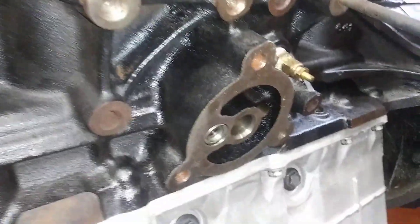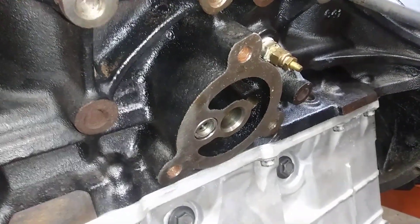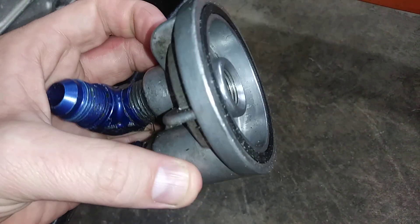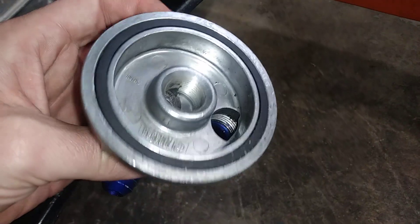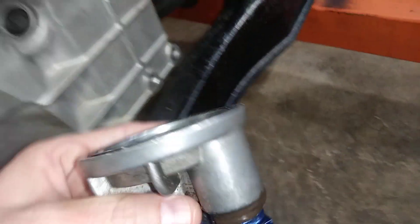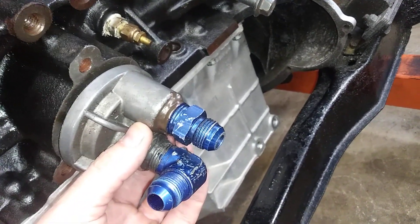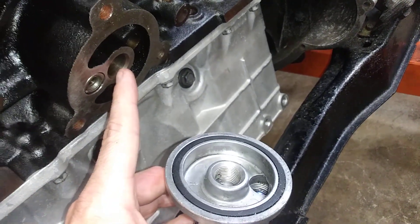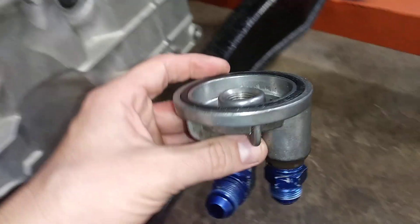It's not a big deal — it's an easy solution. Here is my external oil filter adapter, and the reason why I can't use this is it's threaded here. On my old engines, I could just thread this onto here and have my remote oil filter. But because that's not threaded and I'm not going to thread it, that kind of rules out this easy solution.